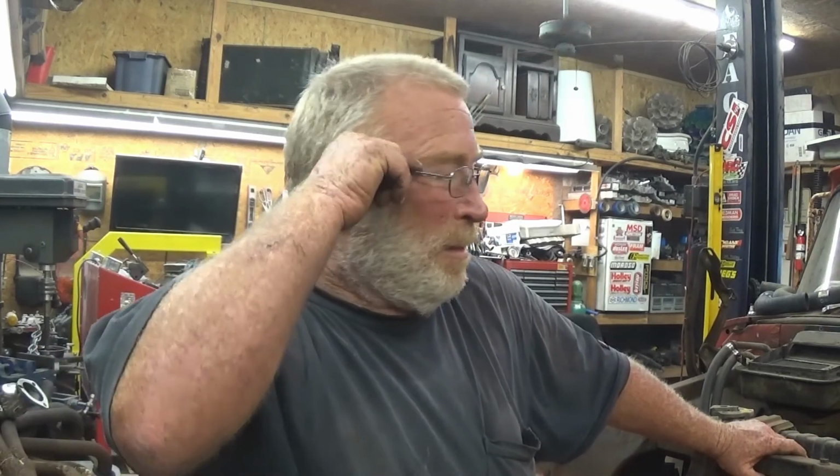But anyway, I got to messing with the brakes on this 65, which anybody been following it knows. I took all the suspension stuff out from under a 78 C10 and put it under the 65, made a 5-lug pattern. Went ahead and put all new brakes on it while I'm at it. Put a new master cylinder for manual disc brakes and drums on the rear, and a proportioning valve off the 78 Chevrolet.